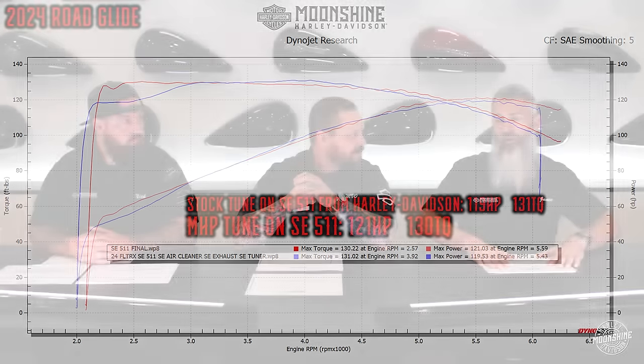In my opinion, the two best cams for this setup are our Moonshine 485 cam and the Moonshine 492. The 485 is the number one all-purpose cam — you can put it in a bike and travel on it, ride two-up loaded down, but also rip with your buddies. It makes great torque off the bottom — over 120 pounds of torque at about 2,400 RPMs — with a very flat torque curve all the way out to about 5,000 RPMs. On the last cam shootout we had torque cams that signed off on horsepower early and cams stronger in the middle or on top end.